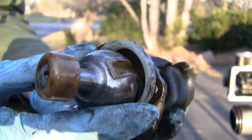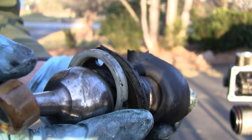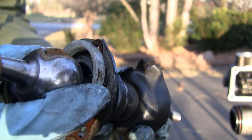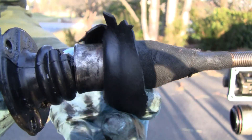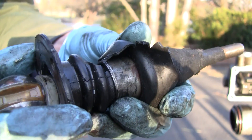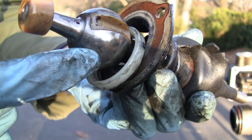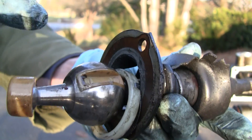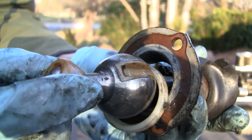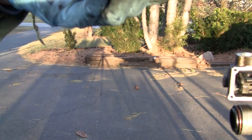First things first, let's take a quick look at the actual shifter itself. I won't spend too long on this due to the variation between models, but for anyone interested — Miata guys especially — here's the stick itself, nothing special, just steel. You have a little boot to keep the transmission sealed and keep dirt out. Then you have two other things: a larger ball, a smaller ball on the end, a little slot on the larger one, a plastic nylon ring up top, and a plastic nylon bushing on the bottom.